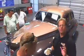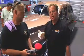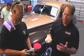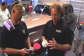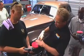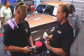So what we're doing now is we've completely machine polished both cars 2 times. Now we're going to machine apply a wax. Now you can do this by hand if you like. Personally, I do everything by machine. You pull your hand out of the process. You have equal pressure over the face of the pad. The machine never gets tired. I get tired, but the machine doesn't.